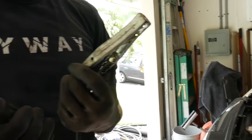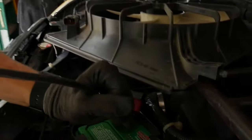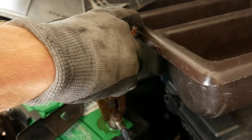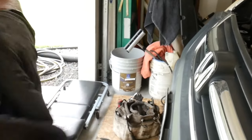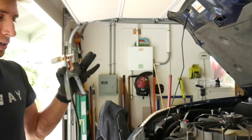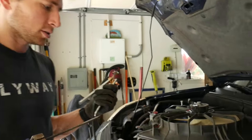If you've got a set of jumper cables around, those work. I'm going to attach them to my car battery. Just as with jumping a car, don't touch your leads together or you're going to get lots of sparks. Then I take the other two ends and grab a screwdriver so that I get pointed ends on them. Again, don't touch these together, and don't let your positive lead touch any metal body parts of the car or anything that will ground it, or you're going to get a bunch of sparks.